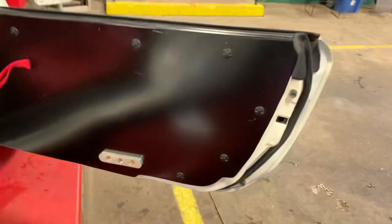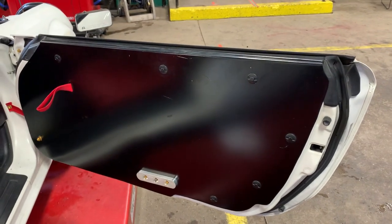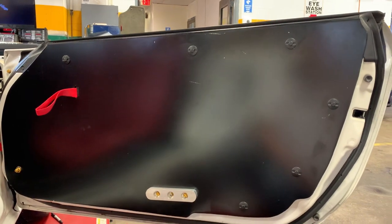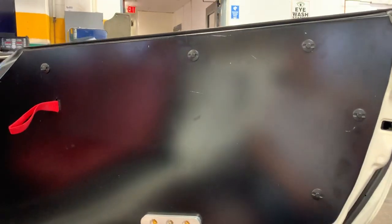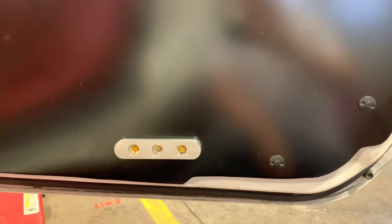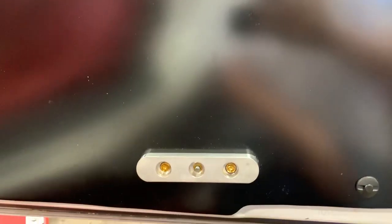People asked me about the door cards - these are something I fabricated up. Same thing with the door release pull straps. The door does require some modification to make them fit. This is the initial prototype version with the aluminum ones - I'm going to make another set out of carbon, and I might do a production run of the aluminum ones for sale to the general public. These are necessary because the factory window regulator bolts stick through.